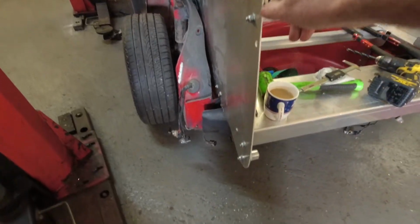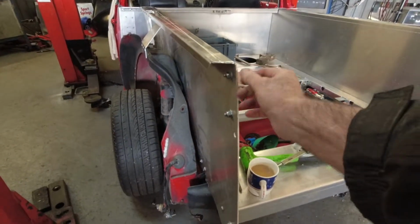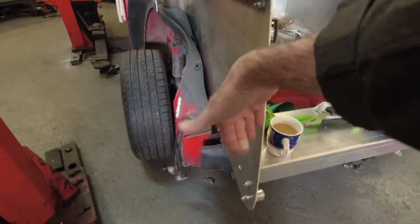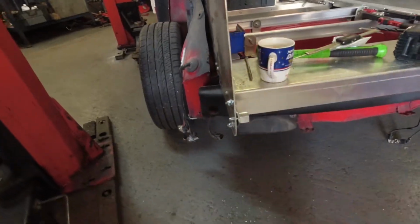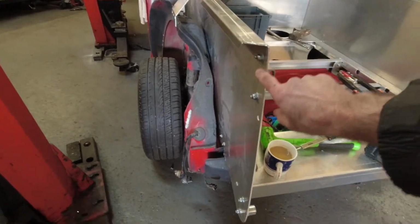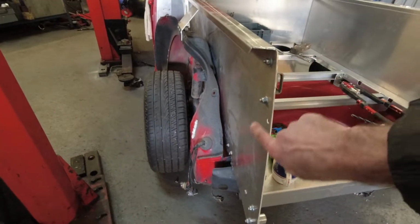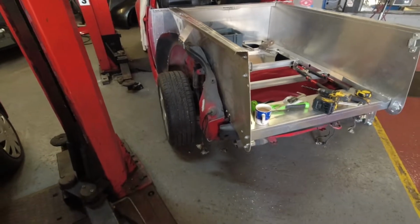I think I mentioned this before, so when you put the rear quarter on and it comes alongside here, there's no rigidity down here to stop it from basically flapping like that. When you connect the two wings together and the bit at the bottom, it's still all a bit loose. So we're going to try and make some plates that are going to match this edge here, and then use riv nuts to hold the plate in place. So that's what we're doing at the moment.